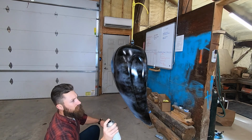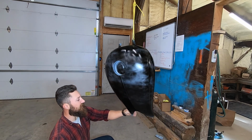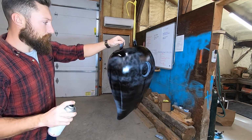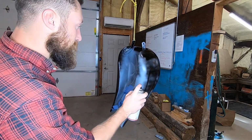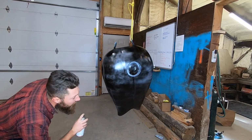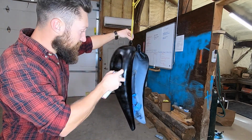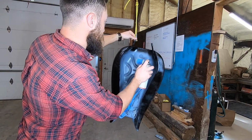So the process continues. In commercial roofing, there is a principle called holidays. If you stop spraying the coating on the roof and the spray dries, boy, that's blotchy, and then you come back and start up again, there will actually be a visible line where you can tell the difference, a slightly different color. So I'm going to attempt to avoid holidays. Probably going too thick, I just don't know. I guess we're all gonna find out.